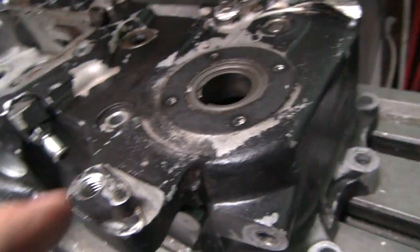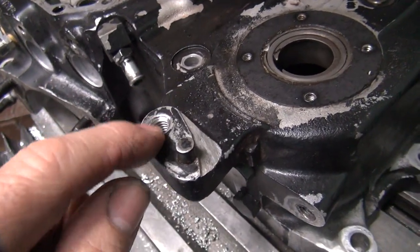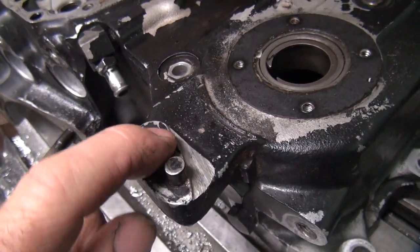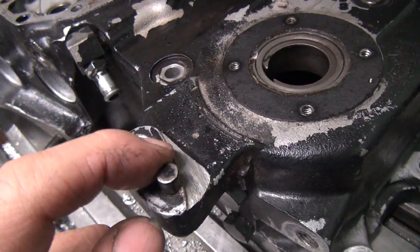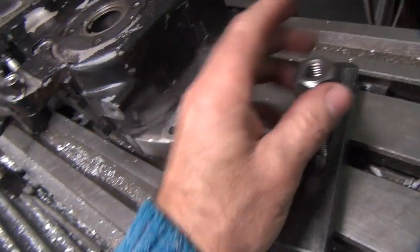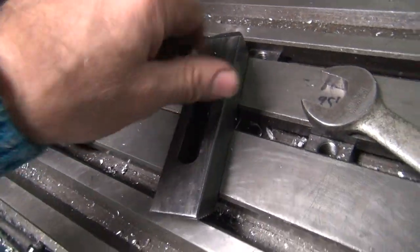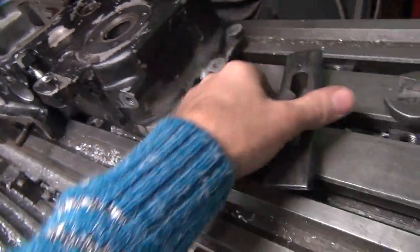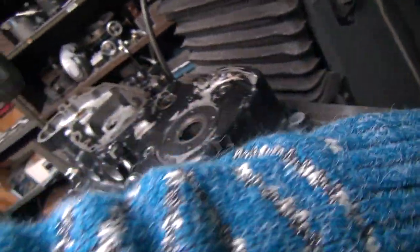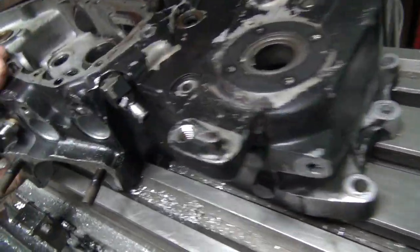around. When you put pressure on the helicoil, it puts pressure on the aluminum. It kind of pulls up a little bit. So you want to make sure that the insert is not ever going to hit the part you're tightening against. You want the case to pull in the part, not the insert. If you don't have it below the surface, the insert will not work correctly and will have problems and come out, and all kinds of problems. That's why people, when they don't put them in right, have problems and they think the inserts are bad. The actual problem was the person putting it in. When you put the helicoils in right, they usually don't have any problems.